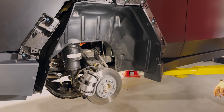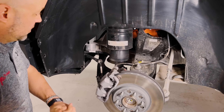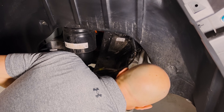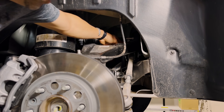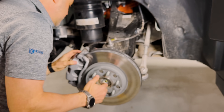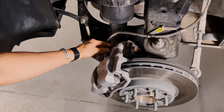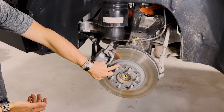Let's get our light in here and see what we've got in the back. Again, more air suspension. Steering is unique back here — let's find the tie rod. Interesting: this is moving up to a fixed point on a rack, so it looks like a fixed point in the chassis, but that's actually a cradle bracket coming out of a steering rack — so that's going to let this rear wheel steer. We've got the parking brake here; calipers are raw, similar to the Model S and Model X type stuff. There may be a zinc coating on the caliper for corrosion protection.